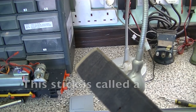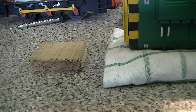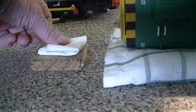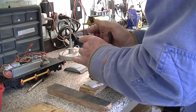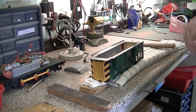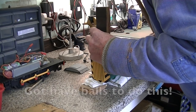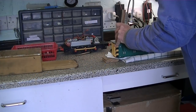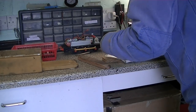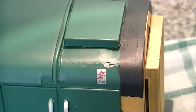So I've rounded off a piece of stick to match the curve of the roof. Now we'll go down inside and see how much damage I'm going to cause as I try to straighten it. Support is going to be all important, so I've got a piece of wood with a tissue and we'll rest the radiator on that. First of all I'll just cut away the screw in there because it gets in the way. Now I'll take this piece of wood and very carefully — oh, that's quite good, not bad at all! There are a few cracks in the paintwork here I'm going to have to deal with, but I'll deal with that later.